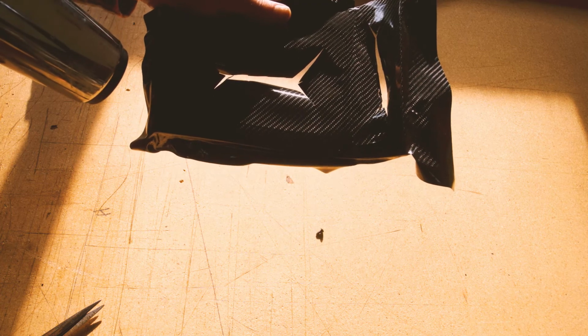So for this, I'm just gonna cut a slit in the wrap in a Y section. I think you can see that there, right there. There's a Y and a slit and another little upside down Y. And I did the same for the ashtray part. And now we're just gonna heat it and make sure that there's no air bubbles at all going on. And this piece will be done. If you heat it before you try to stretch it, it's a lot easier.